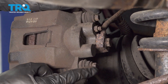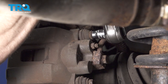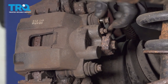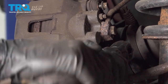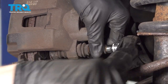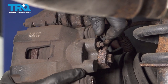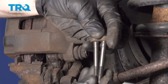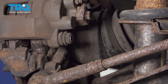Now that we have that pushed back, let's move along to our two 10-millimeter slider bolts. Leave that in there just a couple of threads. We'll grab these bolts — it's a good idea to give them a quick inspection. You want to make sure the threaded area is still in good condition. These look fine, so I'll set them aside.